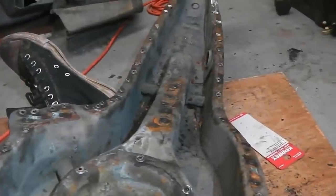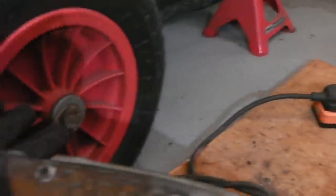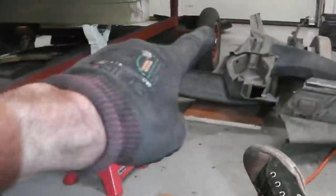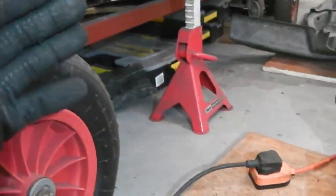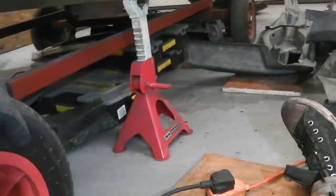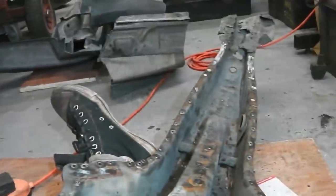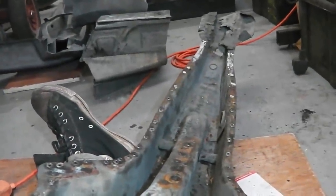So if we found that the axle wasn't parallel, in other words the centre of each wheel to the centre of the front wheel needs to form a square both sides. That's very important. As long as you form a perfect square on your four wheels, then your car's going to drive straight, and that's what we'd make sure that we do.